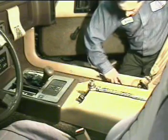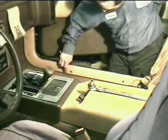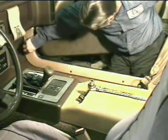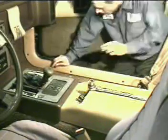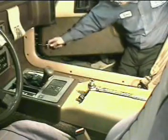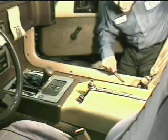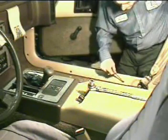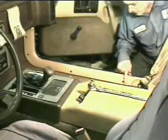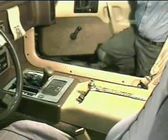So we've got to pop out the five plugs first. Actually, my memory is failing me — these are not screws. These have seven-millimeter hex heads on them. So a quarter-inch ratchet with a seven-millimeter socket will fit in there just fine. I'm not prepared for that, so I've got to go get that.